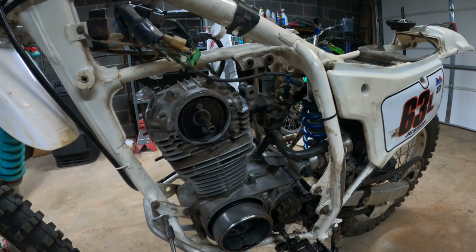I'm going to put a new base gasket, or a new gasket back on this thing, and put it back together. What we're using as a replacement is this Namura cast piston. The difference between this and this Wiseco is the Wiseco is a billet. Has a little bit better heat tolerance, and twice as expensive as this. This is a cheap little piston. This one was a higher compression. This one's stock. It has this friction coating on the side to where if the rings fail you or you lose lubrication for a second, this stuff will save your engine, most likely.